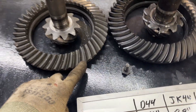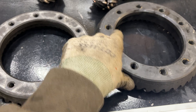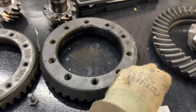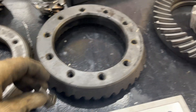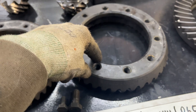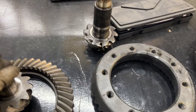The other thing: look at the difference in size of your ring gear bolts. On the standard Dana 44 low-pinion, this is your normal bolt — this is 3/8-inch. On your standard JK — and this is a factory takeout gear set from a JK Rubicon — that's a half-inch bolt. Put them side by side and it is incredibly different. When you're torquing down the standard 44, it calls for 55 foot-pounds. When you're torquing down the JK, it calls for 130 or 135 foot-pounds.